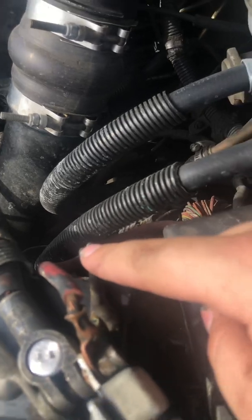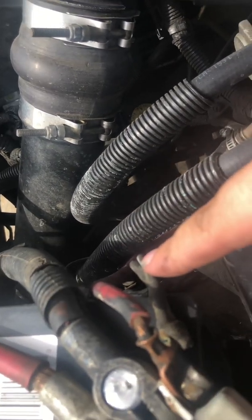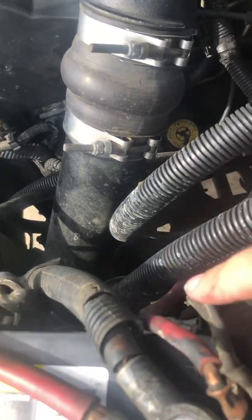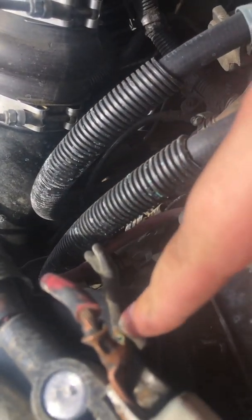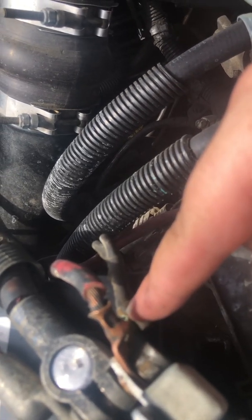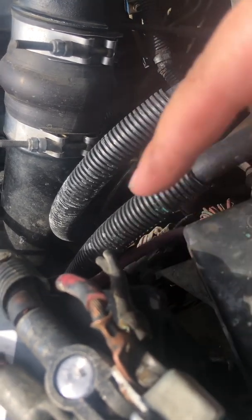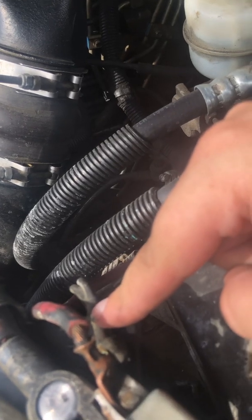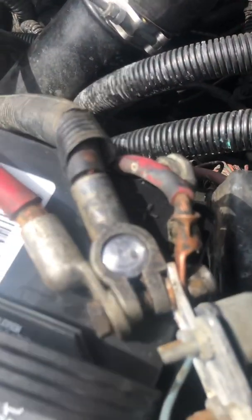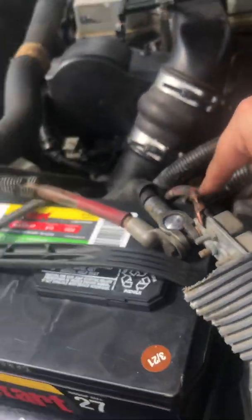I also want to talk about this wire right here — you can tell it because there are two wires going into one connector. It's always the bat signal of Chrysler; for some reason they can't afford quality electrical connectors and just run two wires into one. I need to redo this connector — it had significant corrosion on it. I had been thinking I had a ground problem because I had a CCD warning on my overhead screen and had checked everything in the cab. Found this connector had a ton of corrosion. Used the trick of one cup hot water, one cup baking soda — completely got all the corrosion off. The terminals are much nicer now, and the CCD warning on the overhead is gone.